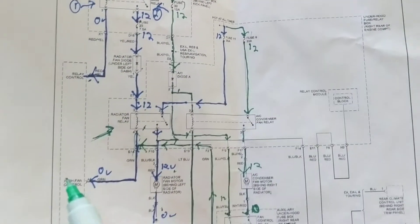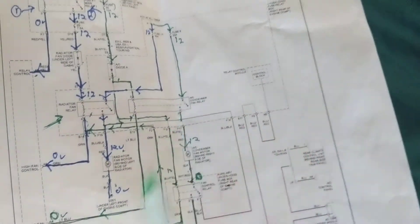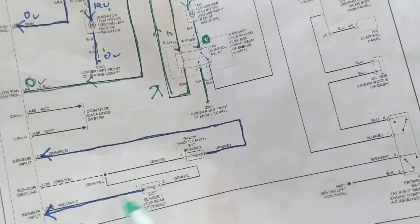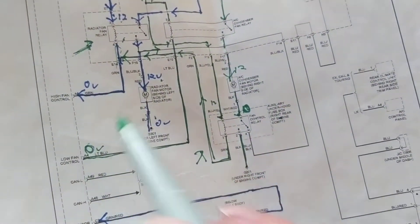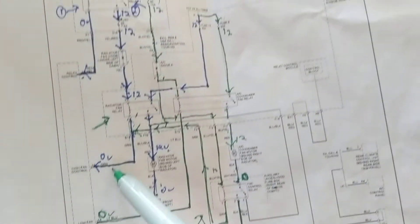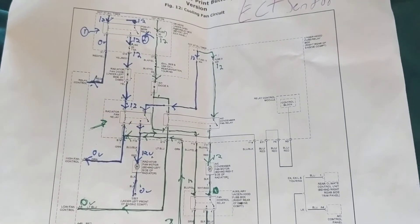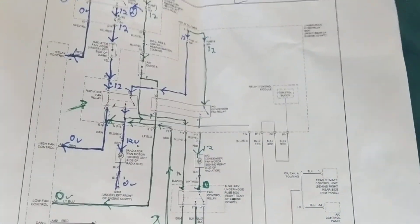This was a quick summary. Remember: ECT sensors both share the same ground. If there's a problem with that ground, it'll knock out both ECT sensors and you won't get a ground from the computer, because the PCM looks at those temperatures. When temperature goes high and voltage goes down, it decides to give them a ground, activating both fans. Please visit my channel — go piece by piece and leave a comment if needed. Thanks.